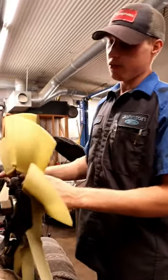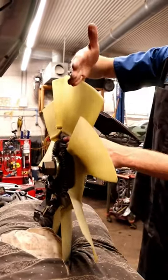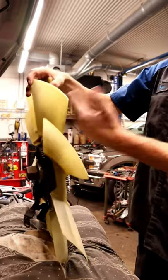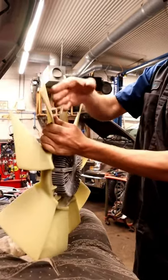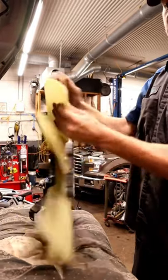What you're going to notice about every single fan is the fan blade orientation is going to be either this way or this way. When I say the front of the fan blade, I mean the closest side to the radiator. If the closest side of the blade is on your left, it's regular threads — lefty loosey, righty tighty.